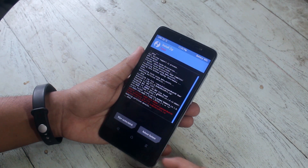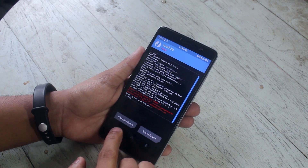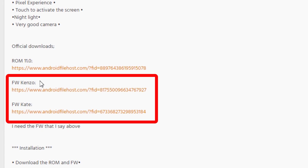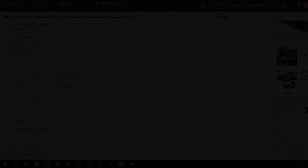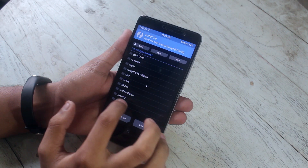I faced the Error 7 issue even while being on the latest firmware. Now I will tell you the correct process to flash this ROM. Go to the XDA thread linked below in the description — you can download the ROM file from there too; it's actually the same file as the official ROM. You need to flash a specific firmware from this XDA thread. It's a firmware by the streaks and it's supposed not to relock your bootloader if you've previously unlocked it officially.